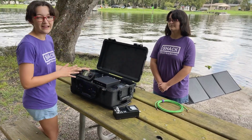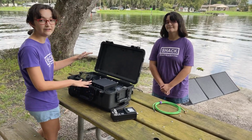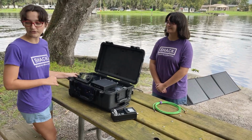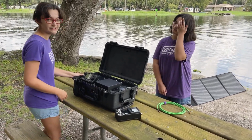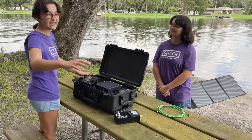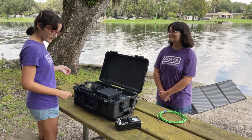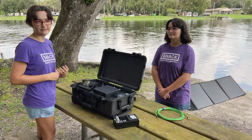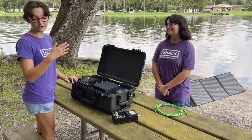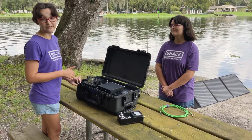And if you're going to be operating out in the field like we are today, it's going to be hot. And since it has your radio and your gear installed under a panel, there's not really airflow, so we were worried that it might overheat, because if your radio reaches about 140 degrees Fahrenheit, then that can be a big issue. It can mess up your radio. So we put a fan over here and an intake over here so that it draws the air. There's a temperature switch next to the radio, which will automatically, at 113 degrees Fahrenheit, I believe it is, somewhere around there, turn on the fan and start cooling your radio. We've used it out in the summer, operating like today, out in the sun, and we've never even gotten near 140 degrees, which is good.